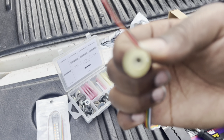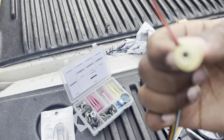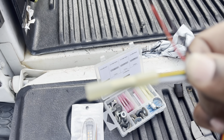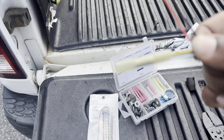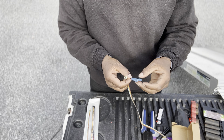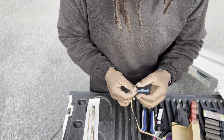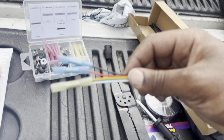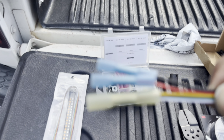I put those three wires inside a butt connector together so they're basically halfway through to the other side — that's perfect because once I put the other wire in there it's going to be touching those wires in the middle of the butt connector. That's where I crimp it, so it crushes the metal and contacts the wire, and it's always going to have a flow of energy through there. I got all the wires with a butt connector on there.